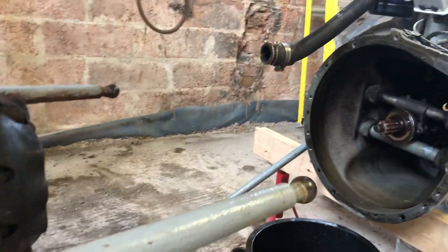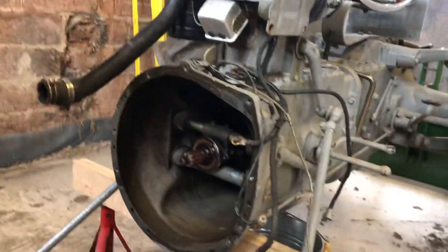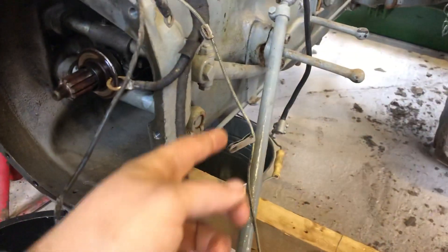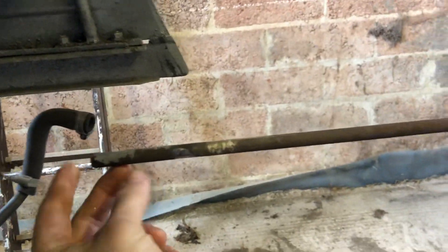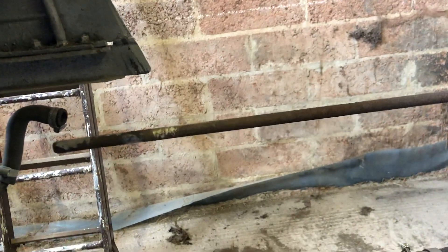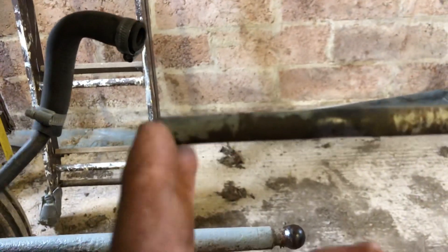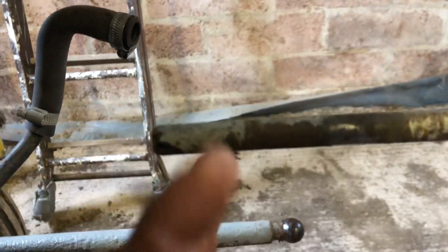The radius arms needed to come out, as did the track rod ends and all the wiring — just the one to the starter, plus the coil, temperature sender, and air filter. I removed the throttle rod by taking the clamp off the end, trying to take as minimal amount off as possible. If you do it this way, mark the position of the clamp on the throttle — otherwise you won't get it back in the same position and it's going to idle differently.